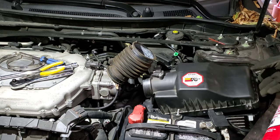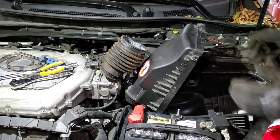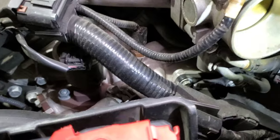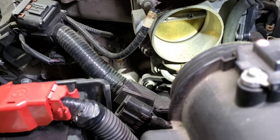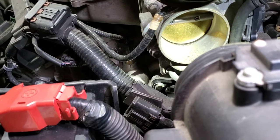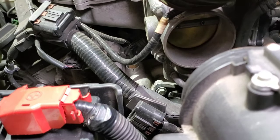After you push this out of the way, just leave it on top here. If you want to clean your filter box, this is the perfect chance — just open it all the way like this. For some reason you might find some dirt in the filter box. It would be nice to clean it so your new filter will stay fresh for a long time. You can see that dirt in there — how nasty it looks. We're gonna put the car into accessory mode and have somebody press on the gas to open the throttle body so we can clean it. If it's just you, find a piece of wood to stick on the gas — I'll show you that in a minute. Take a look at all that dirt — pretty nasty.